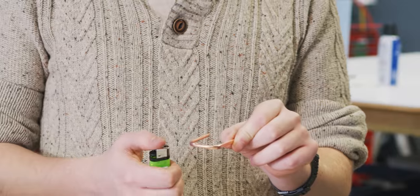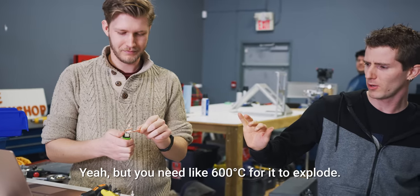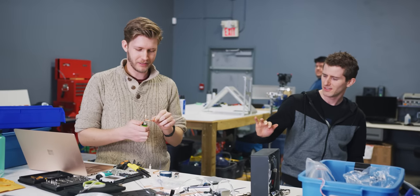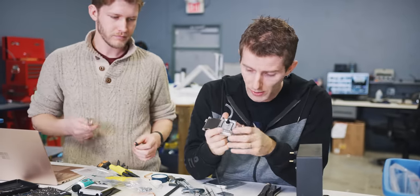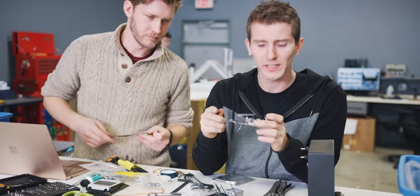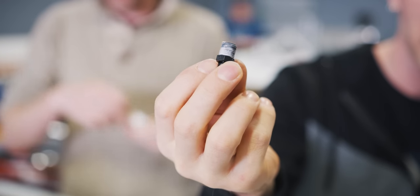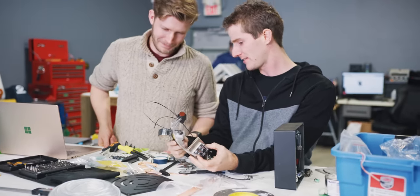So how do you test that? Well, I'd like to say there's a good way to do it. Heating up heat pipes can cause them to explode, but presumably you're not gonna heat it up much. Yeah, my finger's getting pretty hot. Our block is leaking, but I don't think it's around the O-ring. I think it's around the fittings — I popped one of them out and that's clearly not enough Teflon tape. So we Teflon taped the bejesus out of these fittings and it's sticking. Looks good.